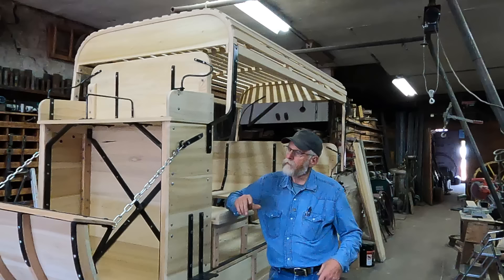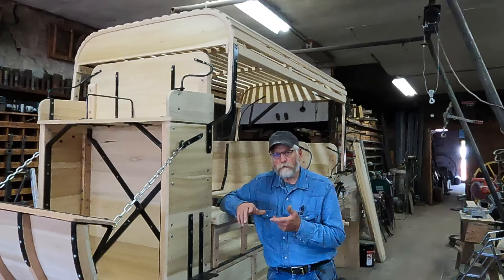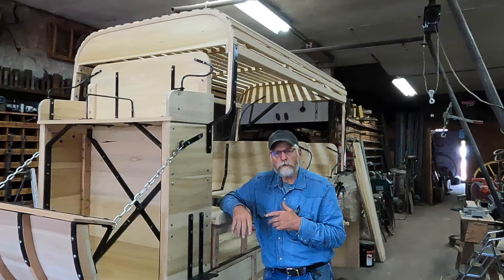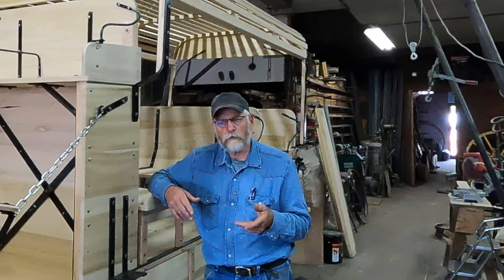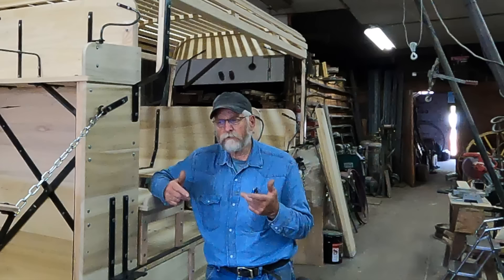In order to mount this body onto the undercarriage, it sits on some leather straps called thoroughbraces. Only part of that was here when it came in, and that's the same way with the turnbuckles — one thoroughbrace came in with the remnants of this coach. I only have one side, so I need to figure out how I'm going to make a duplicate turnbuckle that matches the original.